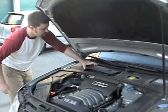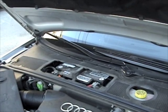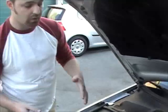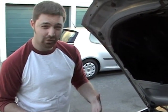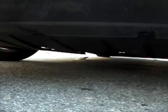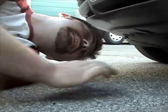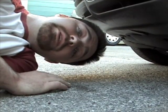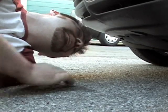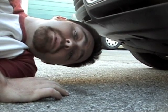Also check the battery — this is something people really never need to check on the road, but do make sure everything is nice and locked down. If you have a car where the battery is in a different position than it originally was, make sure it's not just held in by a bungee cord; really make sure it has a proper lock-down securing it. Next, get down underneath your car and check it out. A lot of newer cars like this Audi will have a big plate underneath, so you won't easily see oil leaks, but it's still a good thing to check. If there's a big enough leak it will have leaked past the bottom. Give it a good glance and see if anything's hanging from the bottom — it'll really save you a lot of time once you get out to the track.